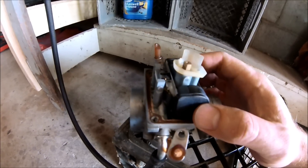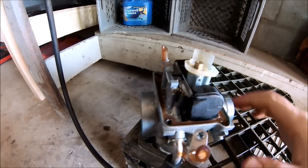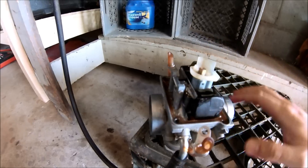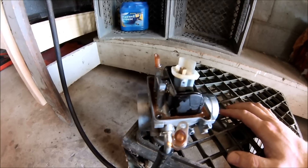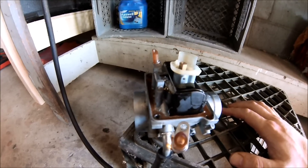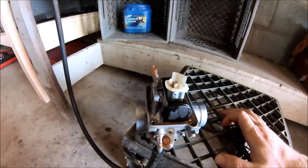As long as you don't put too much fuel on top, if you pick it up you'll see that fuel comes out, and it does seal — it's actually quite a bit of pressure too. You can then blow that out with CO2 and try again to see if it will still seal or not. That's the test for whether or not your needle seat is sealing.